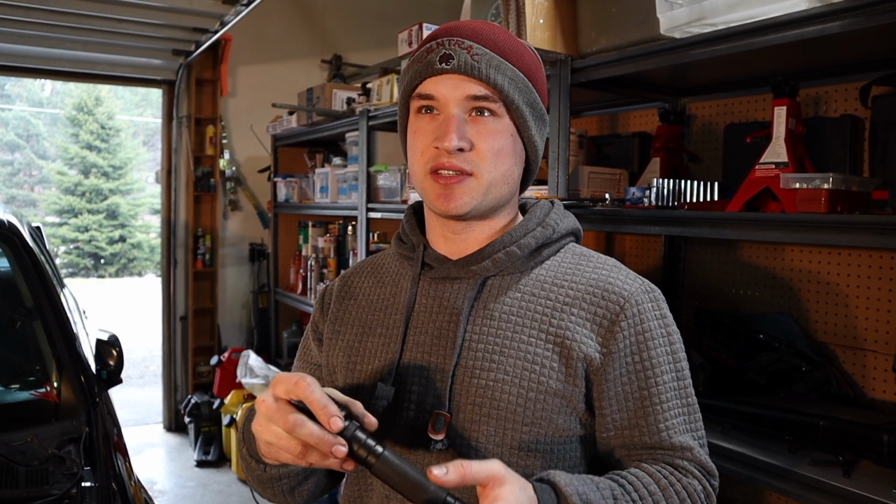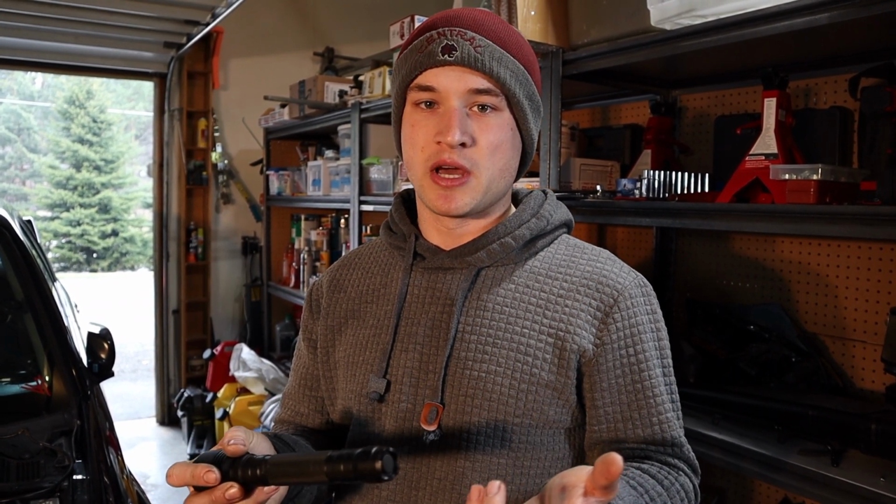And then it ended up taking me, I think, like 4 or 5 hours getting them together yesterday. After I had finished that, I noticed that my car wasn't building up oil pressure for some reason. I also noticed that Sergei ended up filling the oil filter with oil before he put it back on. I contacted some of the members in the group who build motors, and they told me that you're not actually supposed to put oil inside the oil filter before you prime your oil system, just because it creates an air pocket in there, and then it doesn't allow you to prime oil properly.